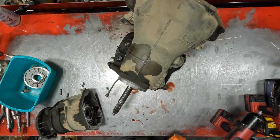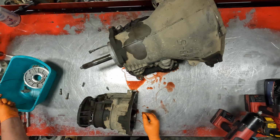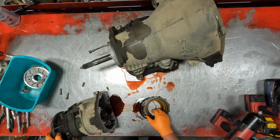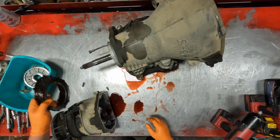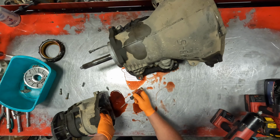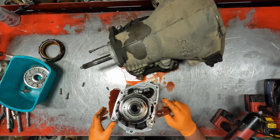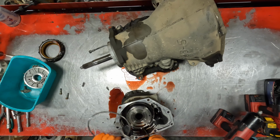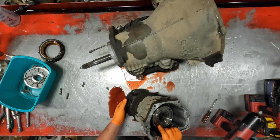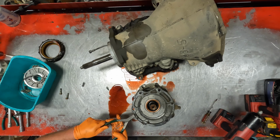Keep up with your selective washer. Like I say, I guarantee you back here is where things went wrong. First thing I see is whoever put it together put the clutches in upside down. Take it back. They did not. See black and blue already right there. Yep, I guarantee you the problem is in this back set of clutches. We'll have to press that apart.